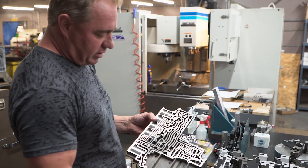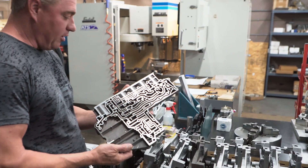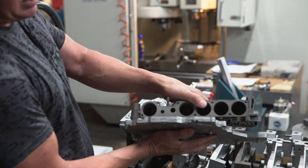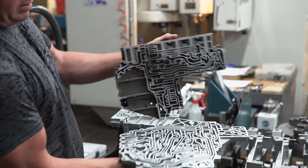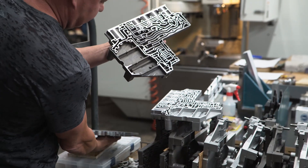I don't know if you can really pick it up in the camera, but you can see the gradients here. This is the valve body portion of the 68 RFE. This is your channel plate portion, and then the two of them go together with the separator plate that goes between them, and you can obviously see all your hydraulic oil passages that take place in there.